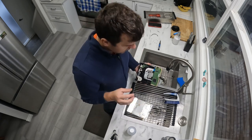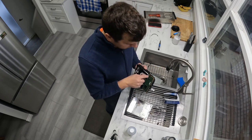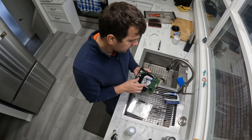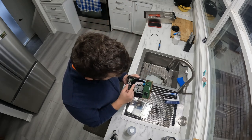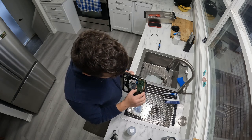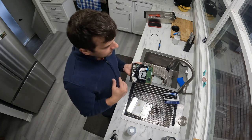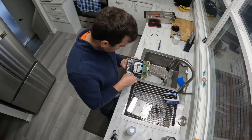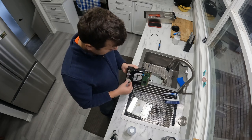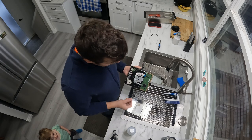Taking off the bottom shielding exposes the daughter board. So the daughter board controls the Blu-ray drive's spin motor that spins the disc, also controls the worm gear, and also the switch position sensor, and also the gear drive that drives the gears to raise and lower the tray, and also accept disc and eject disc. Also, it does the encryption data for the PS3.